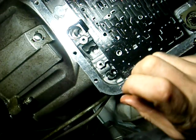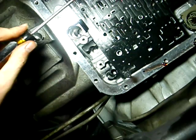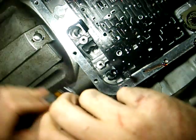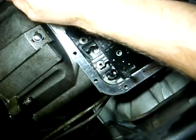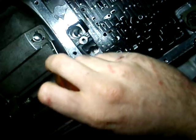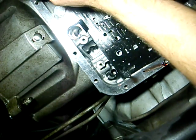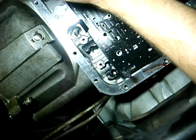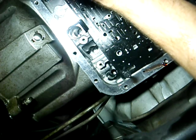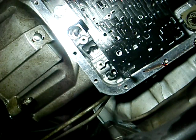I put this shift kit in because of the torque converter clutch lockup problem, and mine has the issue — it's a 98 Firebird. Your torque converter lockup valve is right in here; I don't know if you can see it from the camera angle. I got the kit that not only replaces that but the others too, because it was basically the same price. But I think now I'm wishing I would have done more of it while it was there.